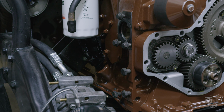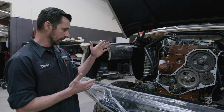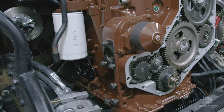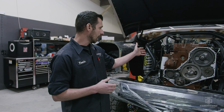So we ended up using the engine mount as our spacer, going into a high shank on the insert for the block, and it still was able to accept the drain lock in there. That way, when we're pushing this thing hard, it's not going to pop that drain out of the block. And then we ended up welding a JIC into the oil pan to accept the atmosphere charger.